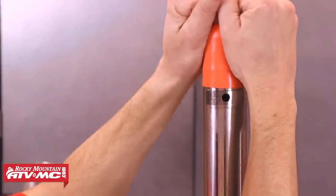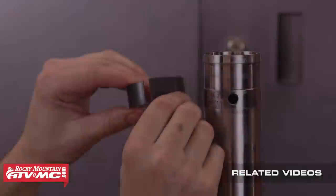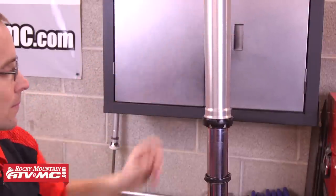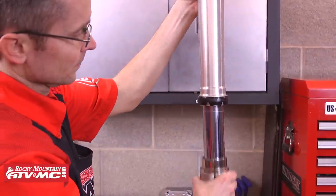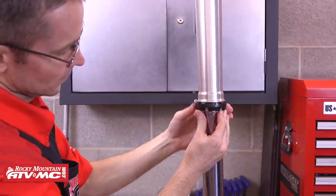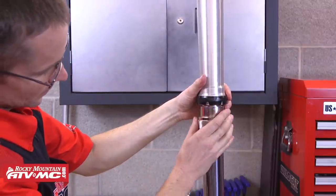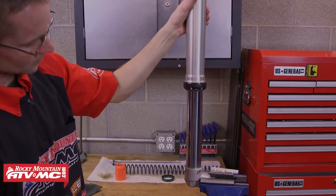Now that we have the oil seal in place we can remove the seal bullet and install the washer, the outer bushing, and then carefully spread the inner bushing and slide it onto the fork and into its groove. Now we're ready to reinstall the outer fork tube onto the lower leg — slide it down onto the lower leg and use the fork seal driver to drive the outer bushing, washer, and seal up into the outer tube. You'll be able to hear when the seal is seated because it will sound solid. After that we can slide the retaining clip up the fork, install it into its groove in the outer tube using your fingers and then the seal driver to fully seat it, and visually inspect that it's seated in that groove. After that push the outer tube down, install the dust seal, and we're done with the outer part of our fork for now. Remove it from the vise and set it upside down onto a rag to let any remaining oil drain out.